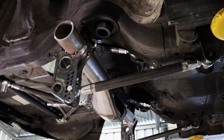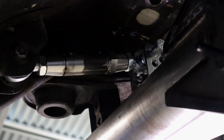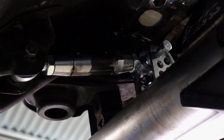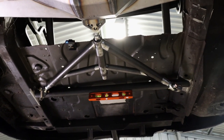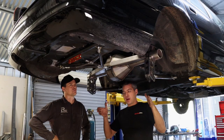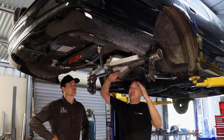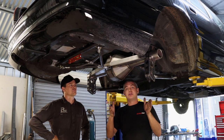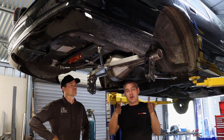We've got the upper and lower control arm brackets tacked on there. Control arms are made, they've been bolted in. Al made up some sweet little alloy spacers, and Matt has just finished off tacking together the track locator on the rear there. So, track locator, self-explanatory. The car on this vehicle had a Panhard rod, which basically held the diff in the center. When the car was raised with that Panhard rod, the diff would actually move to the side.